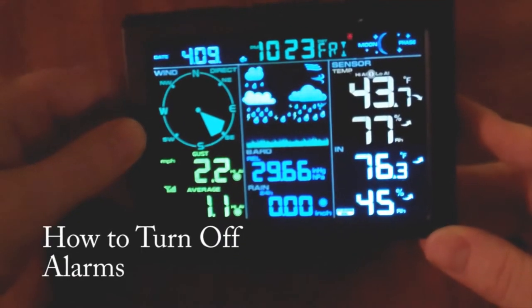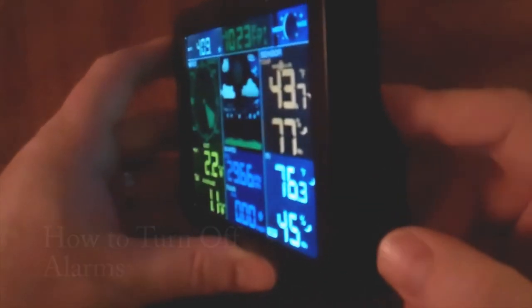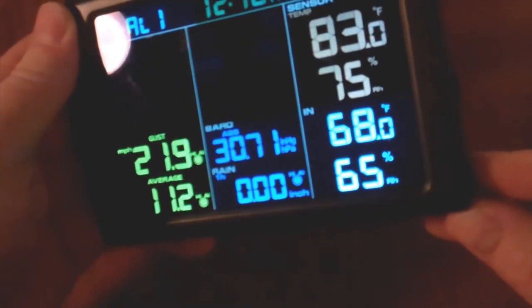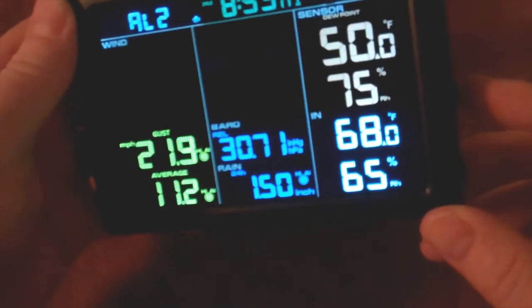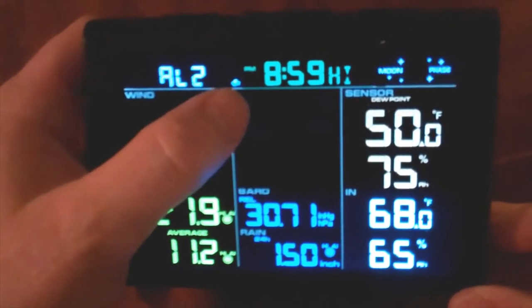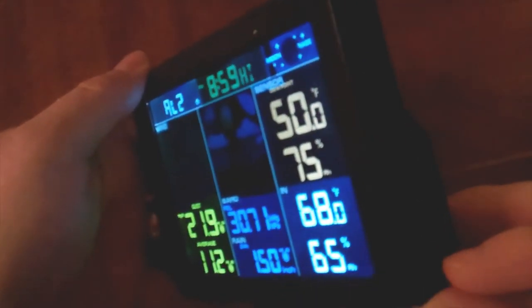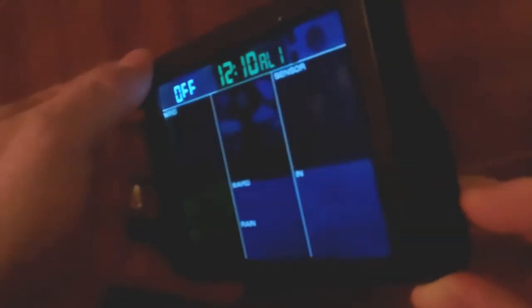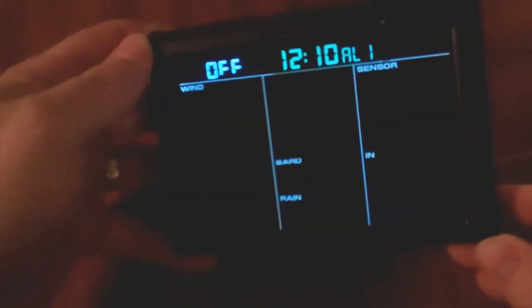If an alarm is going off and you want to turn it off, one way is to press the snooze button — that'll shut it off temporarily. The other way is to press the alarm button. You can see alarm one — it is not set. Press alarm again and then hit set to get to alarm number two. You can see a little bell icon, meaning this one is set to go off. To turn it off once you're in the alarm settings, press alarm once, then press and hold set to get into the settings. Once the values are flashing, press alarm again and that'll cycle it on or off.